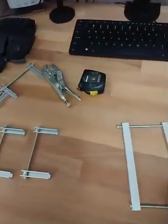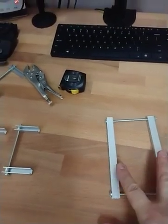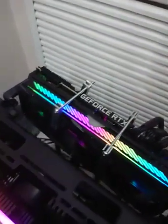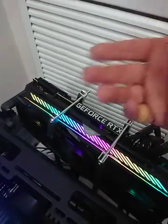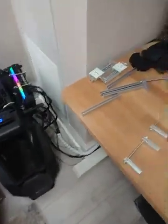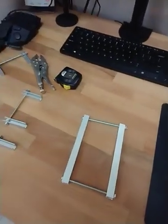Unfortunately, because of the wire connections on this side, I cannot use two full-size clamps. I need to use one full one and then two of the smaller ones. The small one goes like that — you can see it in there. Because the wire connections are on the bottom of the GPU you can't go all the way, so I'll put one smaller one in there and another short one from the bottom on the corner, then this full one. My initial single clamp gave like a two to four degree improvement, and switching to this setup should give even better results on the MSI as well.